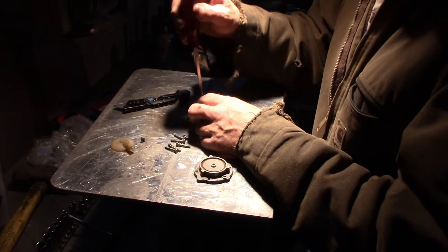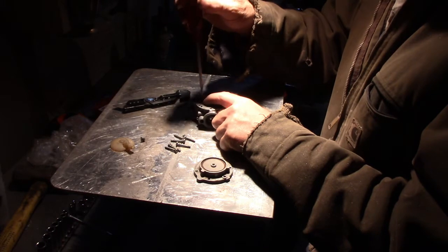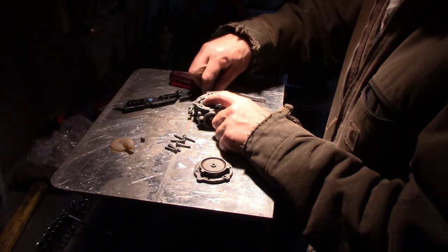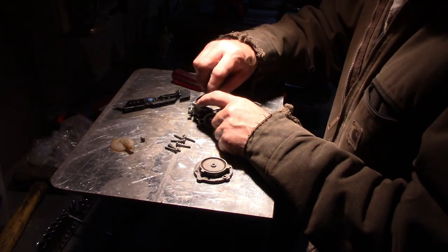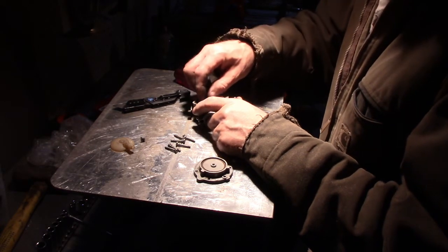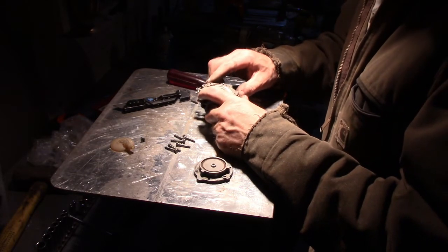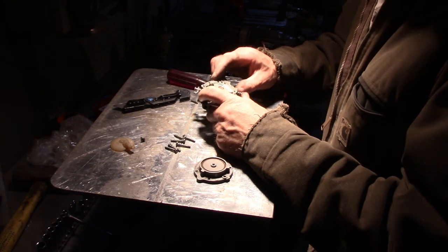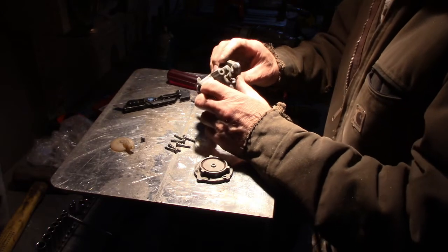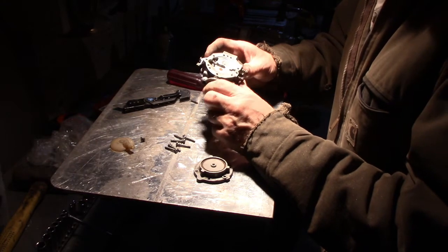So the needle in the seat, there's a spring under there, so get the finger on there. Show my magnet screwdriver. I think the kit came with this anyways. It doesn't look like it's gelled up or anything. It's really neatly springy. Huh. Well, I don't know. Looking around, doesn't seem that dirty inside. But then again, we're going to go ahead and blow and clean and squirt everything out.